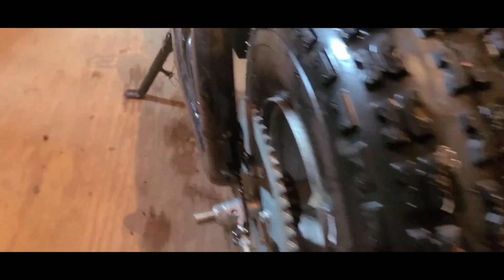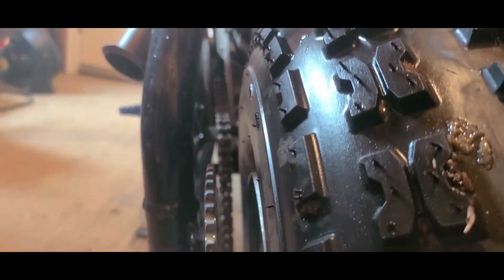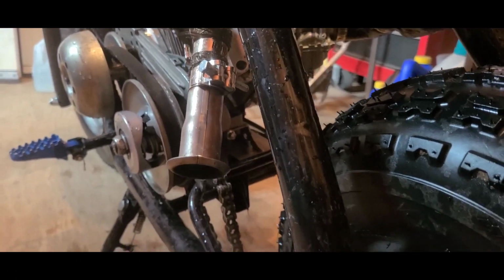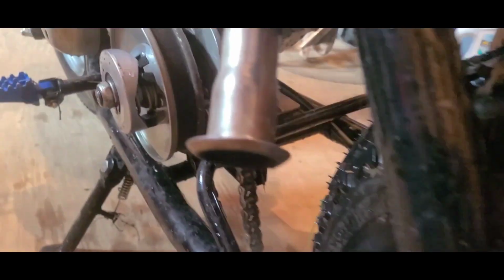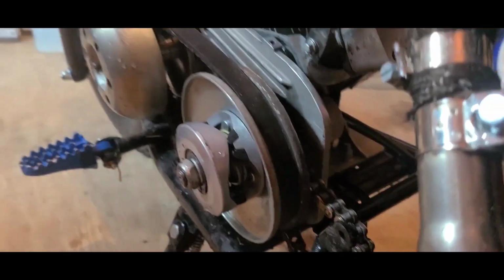So as far as tension with the chain, I corrected that, and I don't think that one washer's width is throwing us out enough to cause an issue up there at that pulley. That's just not that big of a distance. I have the engine all the way forward right now. That can come back so we can shorten that distance. Right now, I'm gonna go ahead and loosen things up, get the chain back on, and we're gonna take a look at the pulley itself where I think the chain was contacting.